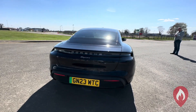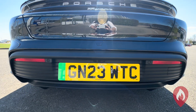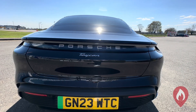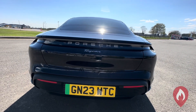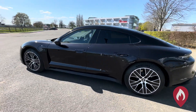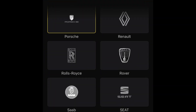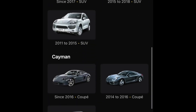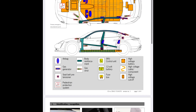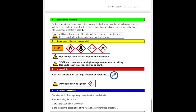The first thing of course is we need to identify it. Now in Australia we have the blue EV badge on front and rear number plates. In the UK they have this green stripe on the left that tells you the vehicle is electric — it's only come in fairly recently so not all cars have it yet, but that's the first way to tell you're dealing with an electric vehicle. As always, look for the external badging, get to know the shape of these vehicles, and then pull up the emergency response guide. Not currently on the ANCAP app, but I found it on the Euro Rescue app — this is the rescue sheet of about four pages.